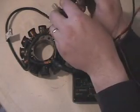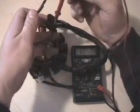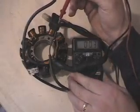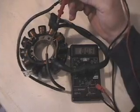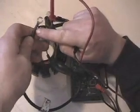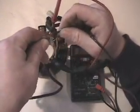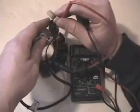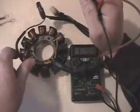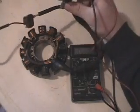You can also check the ground wire — just go ahead and check the eyelet to the male connector. Same thing: low ohms, about 0.3 ohms, just looking for continuity. Usually if something's going to break, it'll break in the joint somewhere in that connection on the eyelet. As long as they have the shrink tube on them they're usually okay, but sometimes you run into sleds that guys have worked on where things are spliced and things can get messed up in a hurry.